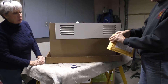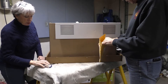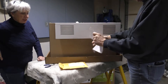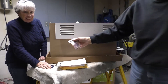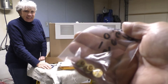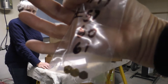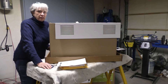So it does have the instructions for installation. It came with a package of orifices — that's basically what the altitude kit is. They're just little brass nuts with a precision-drilled hole in them. We're going to be using the middle one, the number 60, which should be correct for our altitude.